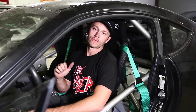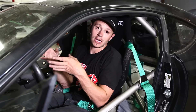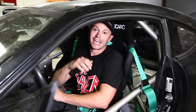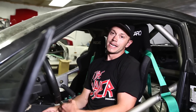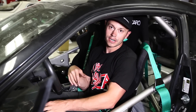We've just finished installing both Profi SPG Recaro seats and we've run into an issue — we had to go back to using the Recaro seat rails on the driver's side because the factory seat mounts were removed when the previous roll cage was put in. That means we can't use the factory seat mounts to mount the Buddy Club super low seat rails. As you can see, there's a head clearance issue — it's fine now, but once you get a helmet in there it's going to be way too high. This is going to have to go back to Pat Sear at Sirius Garage Works to cut this portion of the seat mount and lower it down properly.